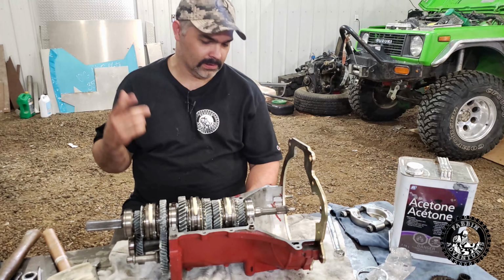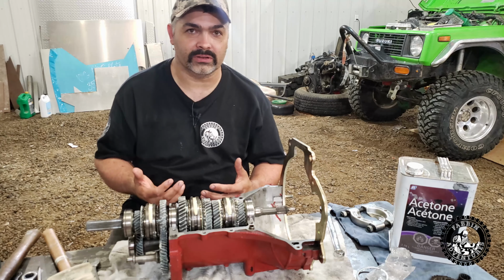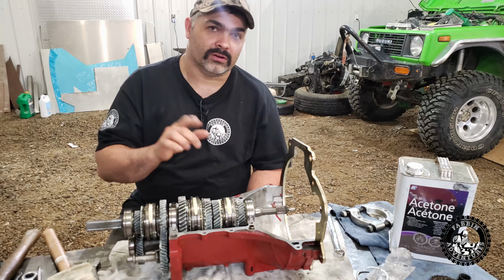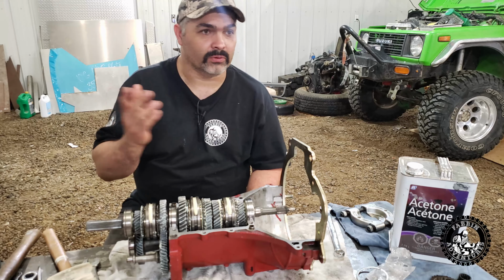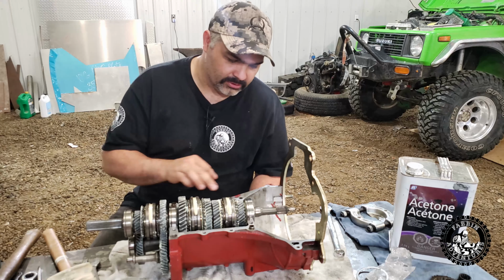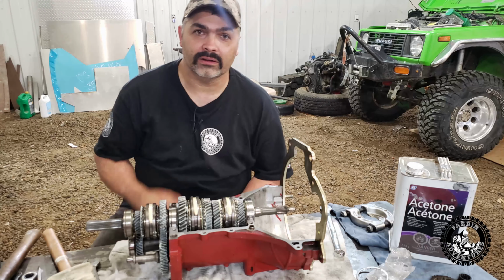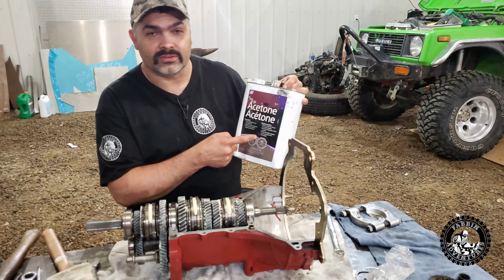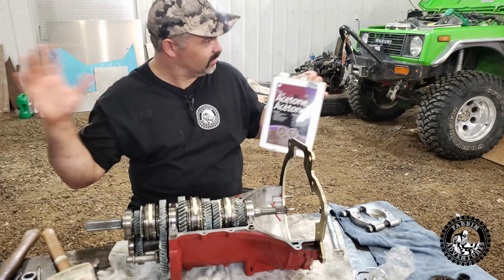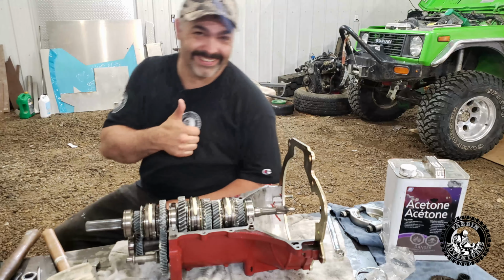Right out of high school, I worked in a race engine rebuilding shop, and we cleaned every gasket surface super clean and either wiped it with brake cleaner, which I would prefer, but I'm out. But acetone works too. It doesn't leave a residue at all. And then you put your right stuff on there, you put your mating surface on there, and you won't have any leaks. I like to use acetone. Acetone is the Frank's Red Hot of a mechanic's workshop, because I put that on everything.